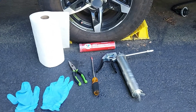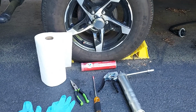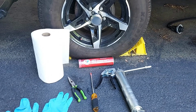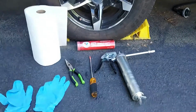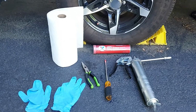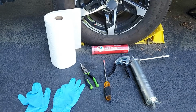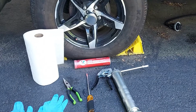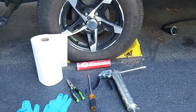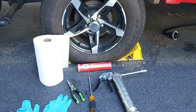and a grease gun. Now, my lessons learned: I did this bearing on this side with a flexible hose. I have a weak right hand, so I had to keep switching back and forth, and it would pop off the grease fitting. So I'm going with a fixed end over here. The grease we're using is from Valvoline. It's a high temperature red grease, the red lithium complex, multi-purpose extreme pressure, and it's also suggested by Dexter. So what I'm going to do next is show you how to insert the tube in the grease gun, and then we'll move forward to the other side to do that bearing.